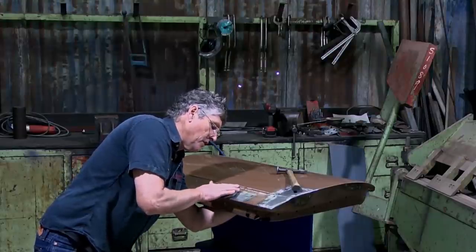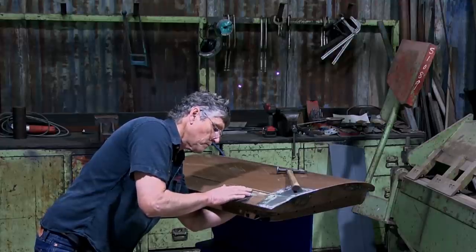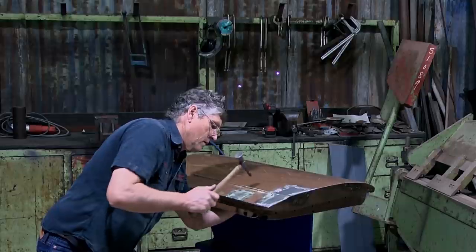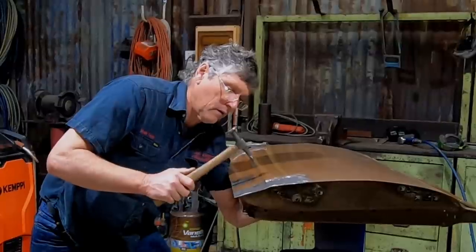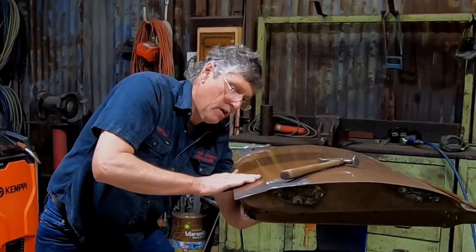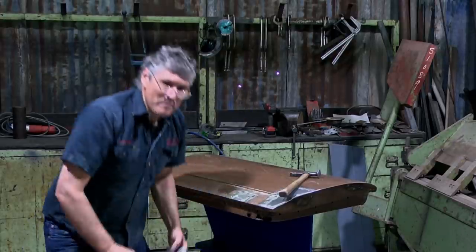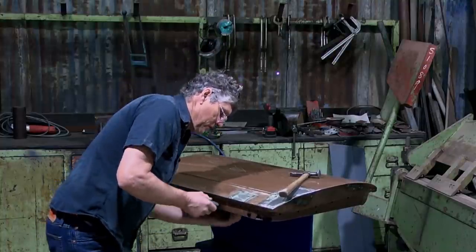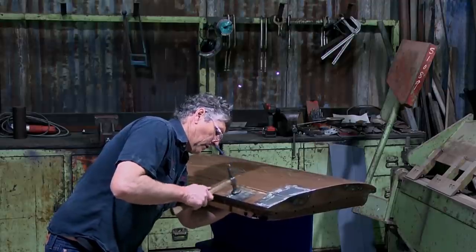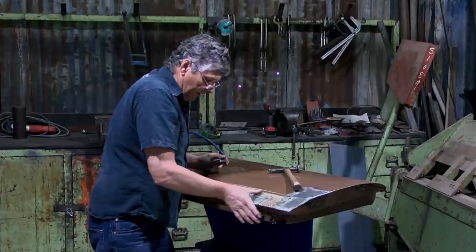What we're doing here is actually stretching the piece of metal through here. As we go along we can feel the areas that have been stretched, and we've got enough depth in that curve that we can tidy that up by grinding and filling. We've got a few spots that are still high. We can get that fairly neat just by working our way along there. A little bit of high just in there — these low areas in the corner are going to need to be worked with the hammer and dolly flat on each other and just get tight on a piece of metal.